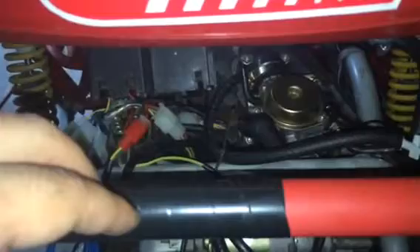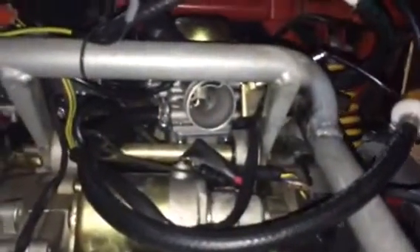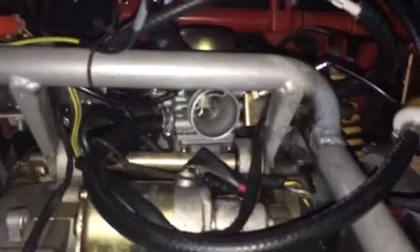I'm trying to think what else I've learned in this whole endeavor — it's been crazy, I've worked on this thing for a couple weeks now. So just a quick recap: you have your petcock with two outlets. Top is fuel, bottom is vacuum. Vacuum tees off to the boot behind the carburetor, and then the other side goes to that side of the carb. Fuel goes just to the fuel filter to the left side of the carb. Very easy — that's your setup. Lots of diagrams online; they don't really help out.